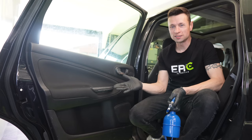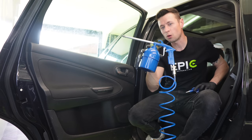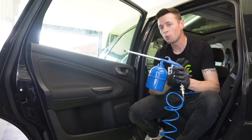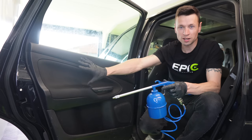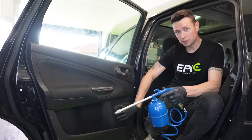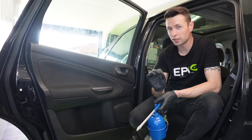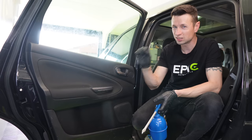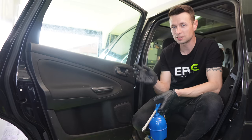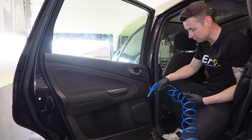What we have here is one dirty door card — it's got the usual bits of crumbs and filth in the pockets. First of all, we're going to blast it out with the blow gun. After that, we're going to resort to one of these, which is a degreaser cannon. All we're going to use is a tiny amount of APC; the rest is going to be water. We're then going to spray the entire door card including the fabric, leaving out the speaker obviously because we don't want to damage it, and then wipe it up with a microfibre cloth. If there are any bits of ingrained dirt, we're going to hold the cannon over it a little bit longer just to see whether the chemical does its job.